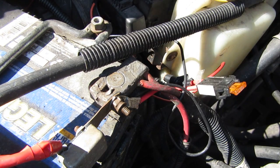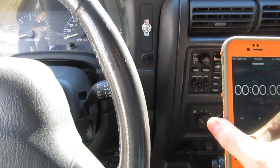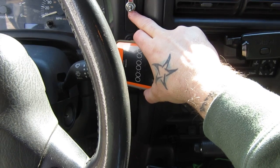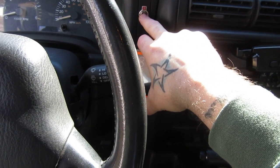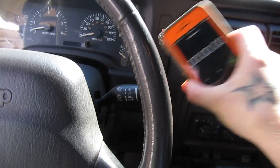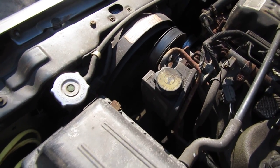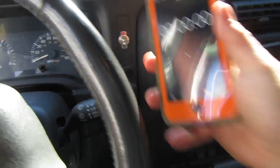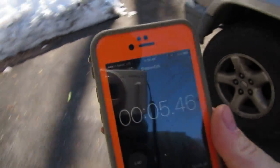And that's about it — I had this little eyelet laying around and that is the whole circuit. Now let's look at how this thing works. I've got this timer set for about three and a half to four minutes. I'm going to hit this switch on — the fan's going to come on — then I'm going to turn it off. As soon as I turn this off is when that time delay relay starts counting down, and the fan will stay on for about three minutes 45 seconds to four minutes. It's on a non-switched circuit so it'll stay on even if the Jeep's not on. Now let's go ahead and turn this off and do a time lapse of how long this thing stays on.